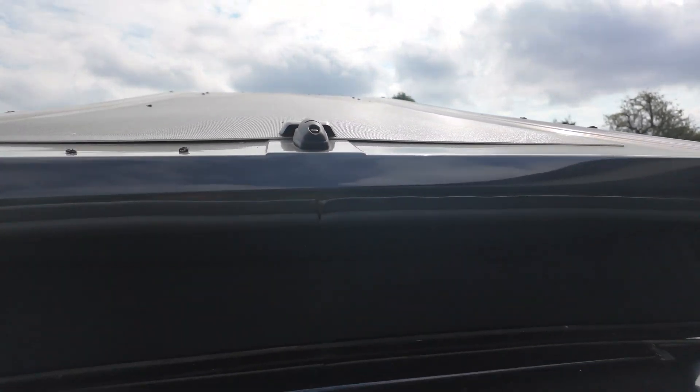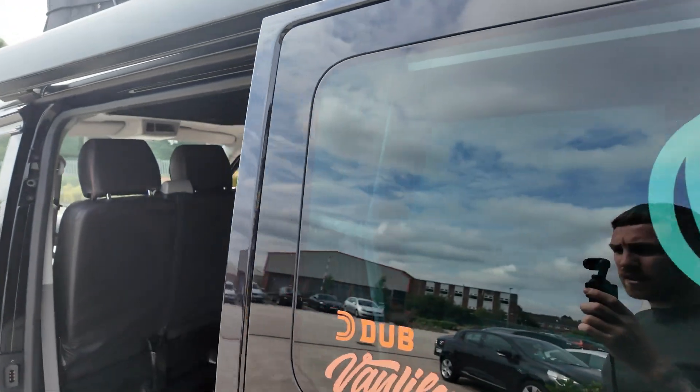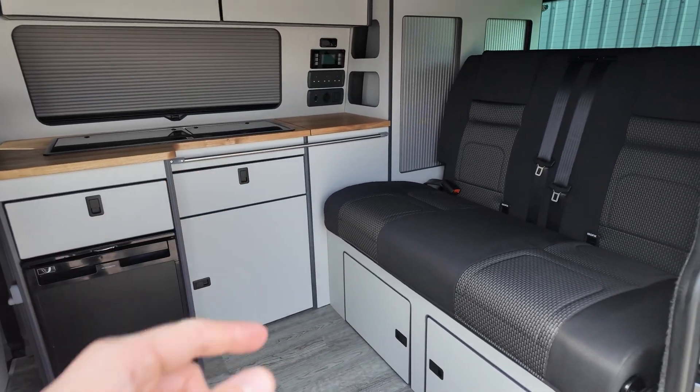The cables go into the van and they then go into what is called an MPPT controller, which is located somewhere in this conversion that we've done. The MPPT controller is basically a component which regulates the power input from the solar panel into your leisure battery. It will read the voltage of your leisure battery and decide whether the battery is charging or just needs some float charge, and you'll be able to figure all of this out simply by looking at the app provided with the MPPT controller.